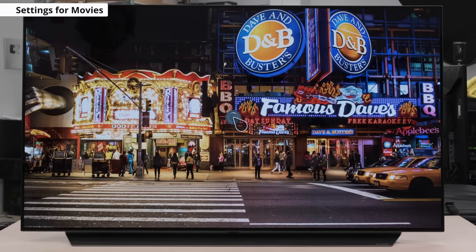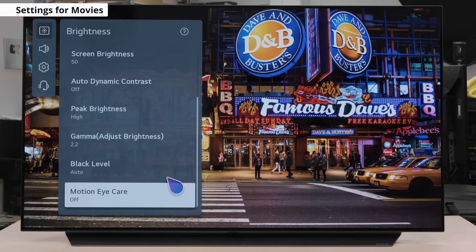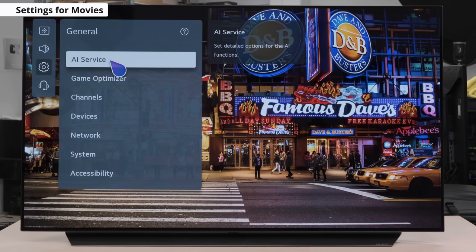Now that we've gone through the interface, let's look at the initial setup we recommend. The very first thing we recommend is to disable the power saving mode and the automatic image modes. We do this because we don't want the TV to adjust the image and brightness automatically while we're viewing content. Sometimes these features can be distracting to our viewing experience and can alter some of the finer details of the content we're watching. So what we will be turning off is energy saving, AI service, and motion eye care, which is found in the picture menu.